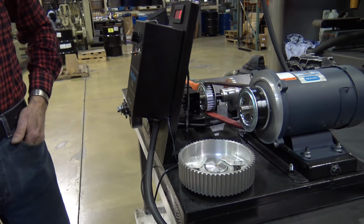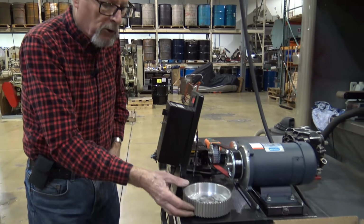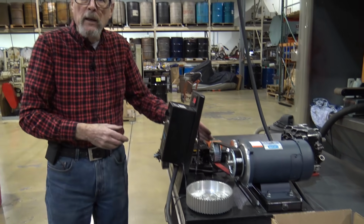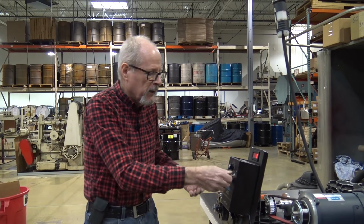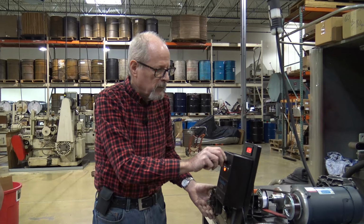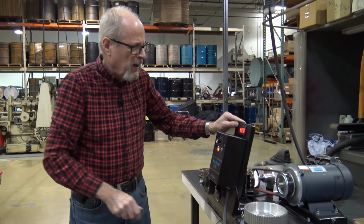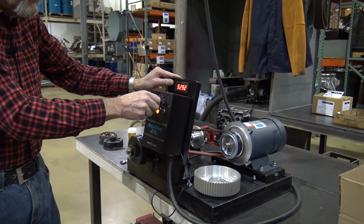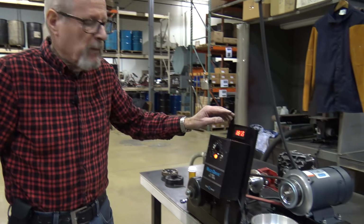When I have two-cycle engines and I want an engagement above 7,000, 8,000, all I have to do is switch this gear with this one, and that will give me my 8,000, 8 to 10,000 RPM. Because this one I can get up to 5,000 RPM is what I can get this up to. When I put this pulley on it, I've doubled it.